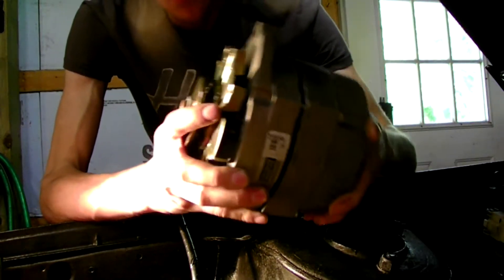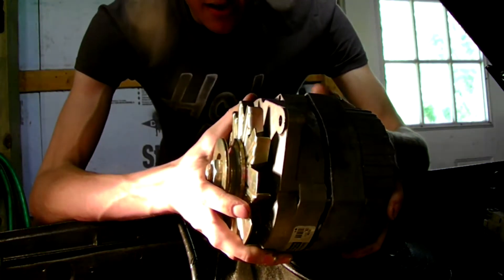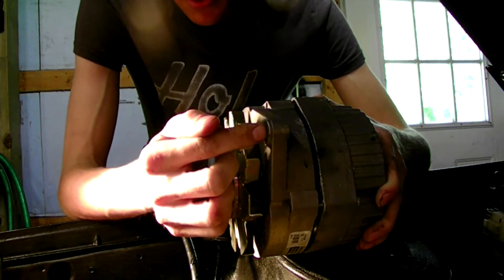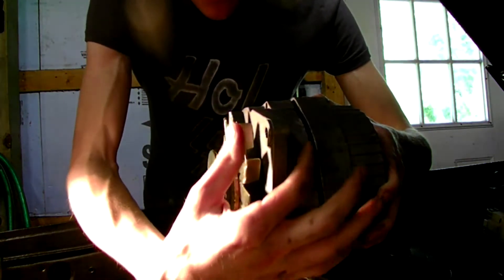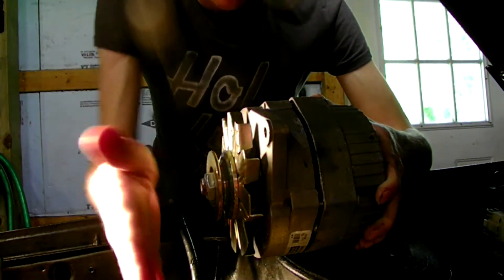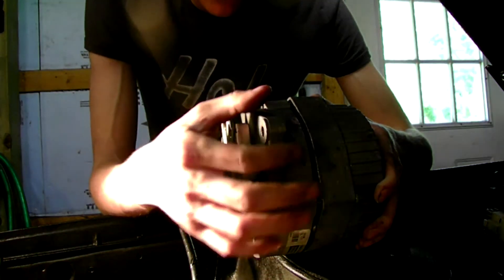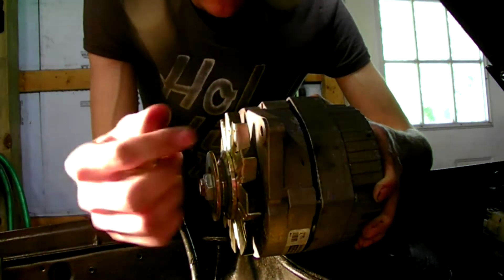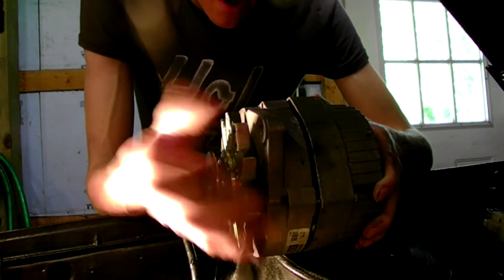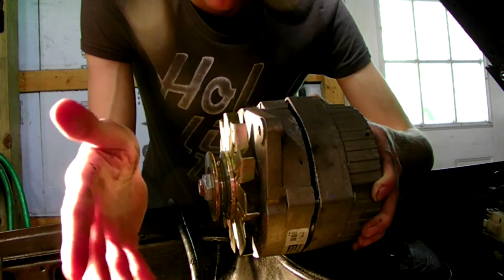The smaller flange on the top of the alternator is going to go up to where the threaded block is. One issue you will run into is that if you get a GM one wire from AutoZone or Advanced or anywhere, this is threaded and the block is threaded, but they're two different threads. The easy way to fix this is to take a drill and cut the threads out, which essentially sleeves it, then you just get a longer bolt and run it into the factory block mounting position.